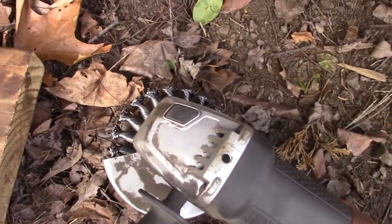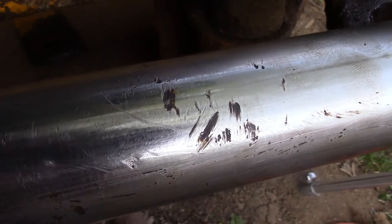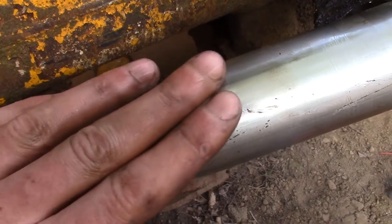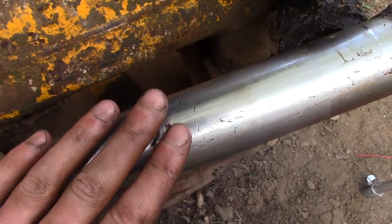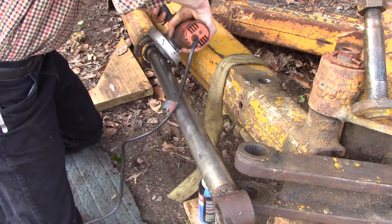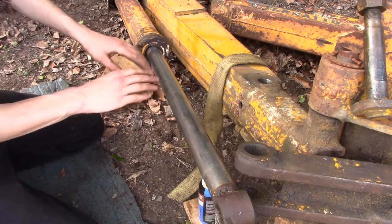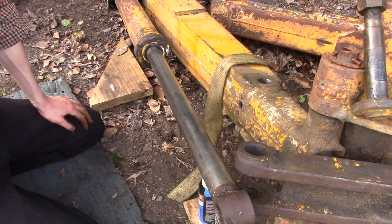Then I'm going to use my wire wheel to clear out some other areas. You see these areas here — they're older and they've filled up with rust and dirt and gunk over the years. They've actually smoothed themselves out a little bit, but I'm going to clean these out with the wire wheel so it's just bare metal. I've wire wheeled all these spots gently — you don't have to go after them too hard. You don't want to damage what good chrome you have.